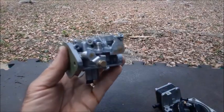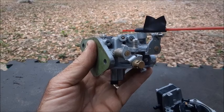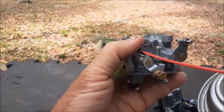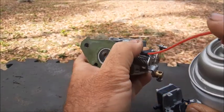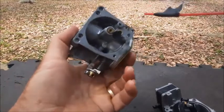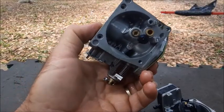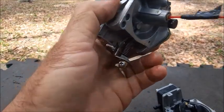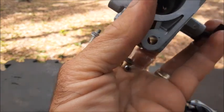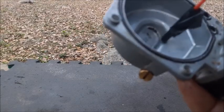Now we're going to take our carburetor cleaner and put it into these holes and blow them all out. I like putting a little piece of electrical tape on the carburetor cleaner tube because when I insert it in there, I can actually make it seal up against that orifice hole, and then I can blast through there and it'll blow out somewhere inside this carburetor. You can see it blows out the back side of the carburetor here. Let's go ahead and do the one for the gas input right there — okay, that's clear. You also have another jet valve right here in the bottom, so put the tube in there, push the electrical tape up, and this should blow out somewhere inside the carburetor also. You can see it right there inside the carburetor throat as it comes out. We'll also clean out the bottom of this carburetor bowl and get the crud that's in the crevices cleaned out.